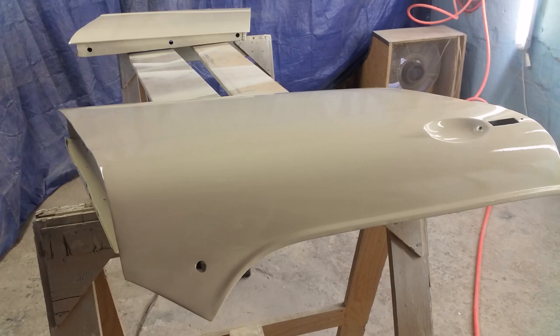Well, this is the end of the paintwork, and it's a good thing too — I just ran out of paint. Those things coincided together. It's been a long process, quite a learning curve. There are things I would do differently from the beginning. Doing these doors — these are the straightest part on the car — I probably would have started with them to begin with. It's straight, it's simple. When you're doing blocking on a straight or semi-straight surface it makes a lot more sense than doing it on a curve.